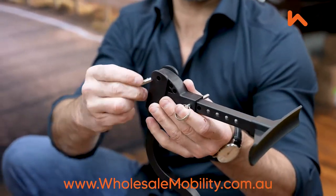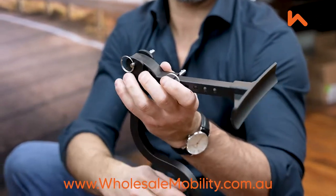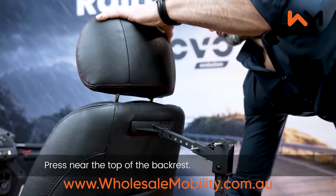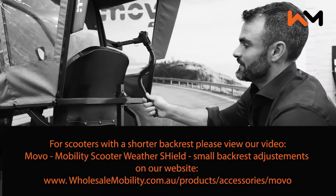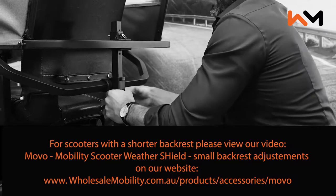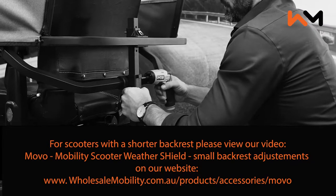Once assembled like this, insert this into the top of the attached frame on the back of your scooter and secure with the pin. Slowly recline the seat back to your preferred position. You may need to adjust the bracket angle using the pin to ensure it hits at the top of the backrest, not the headrest. If you have a scooter with a shorter backrest than 51 centimeters or 20 inches, please ensure you familiarize yourself with our video for this.